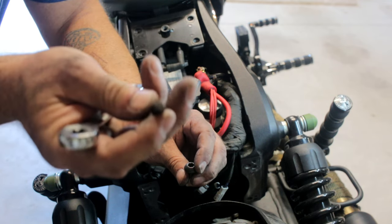Next I'm going to flip it over and put the screws that came with it in here, putting those where those 15-millimeter bolts were. These come with the Tank Machine block-off plate and these are going to be six millimeter. What we're going to do is tuck these bigger plugs down behind it because there's room behind this little void behind the battery box. If I do that then I should be able to force the plate back on and smoosh it all up and tighten it. So that's what we're going to try.